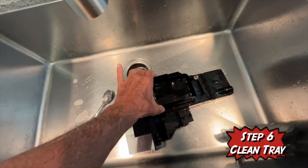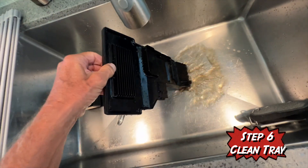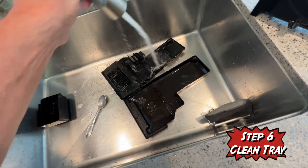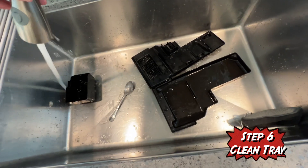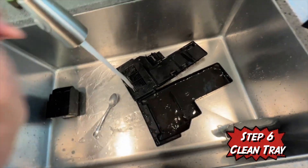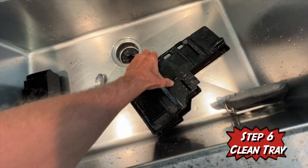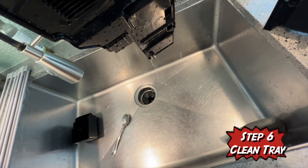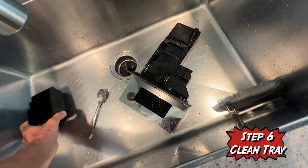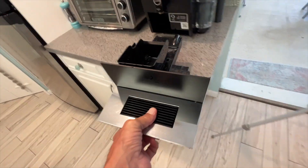Both this and this thing here are completely filled with water, so I've got to be kind of careful so I don't spill it all over the floor because there are caustic chemicals in this water. So let's go ahead and set her there. Try not to get it on you. Pull this off, then let's just drip this out. We're going to flip it over and rinse it off. Then we've got to get all the water out, put this back on, let it drip out, put this back on, and dump the water out. Now we can put it back in the machine — it's wet, it doesn't matter. Slide it in.